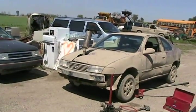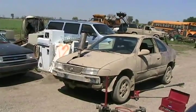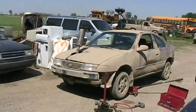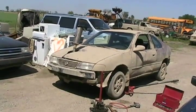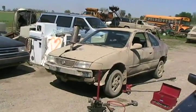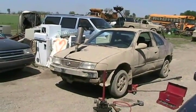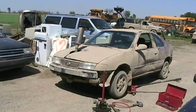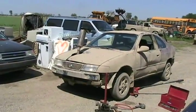The problem with our 1995 Nissan 200SX, a.k.a. Sentra in disguise, is that the inner CV joint on the axle that goes through the transmission separated and popped out. Normally you can put them back in, but under closer examination, this car has the wrong axle installed. It's an inch too short. It was probably meant for an automatic.